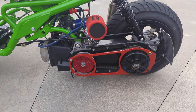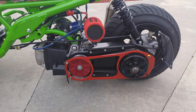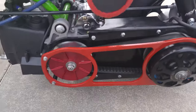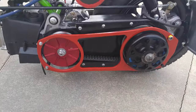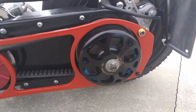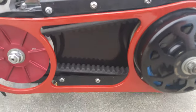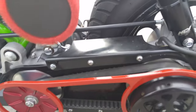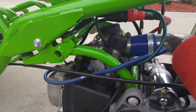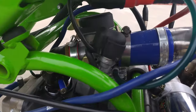This is the bad boy right here — it's a David Bullock 205cc bored and stroked engine. I've got the Composite Bone Ankle Biter, Banjing Variator, Banjing Clutch Bell with NCY Clutch, the War Fab Case Brace, custom intake, and Uni-Filter.